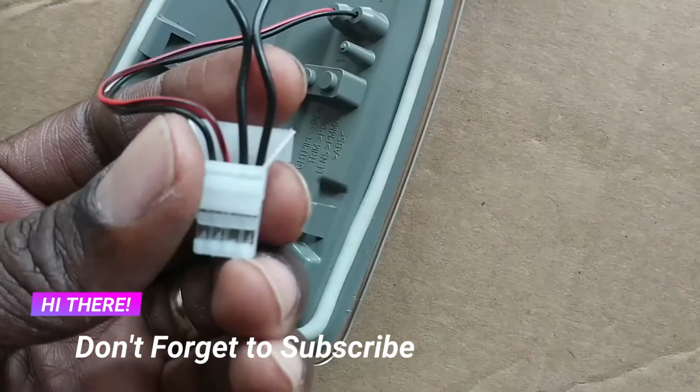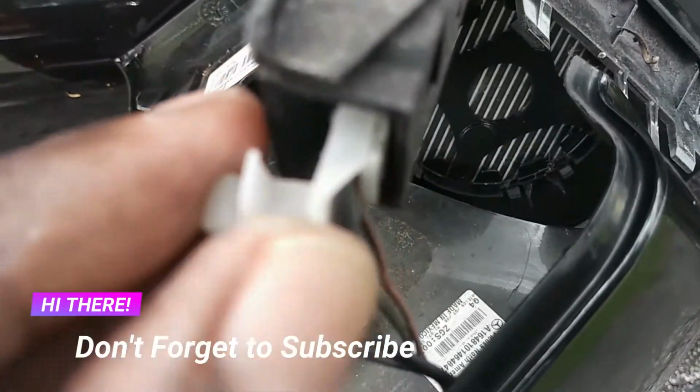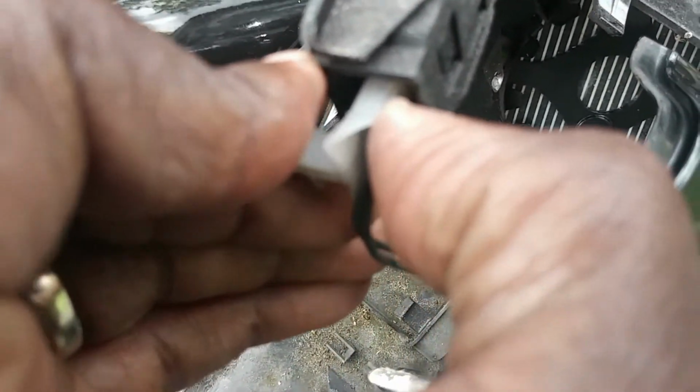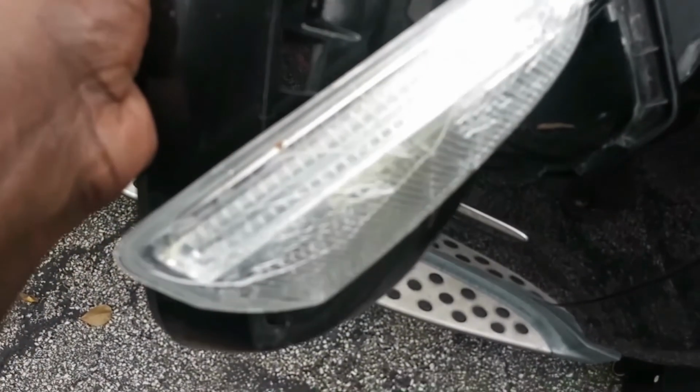Now we are going to install it. To remove the turn signal light, we have to release the connector by pressing on that little plastic here and pull it out. Squeeze and pull it out. And we're gonna replace the turn signal light. Installation is a reversal of the removal.